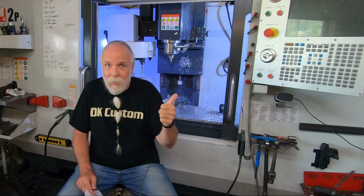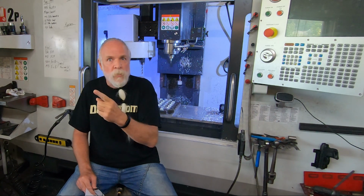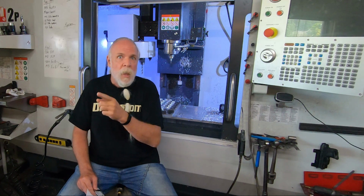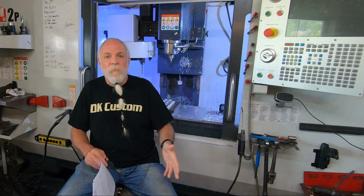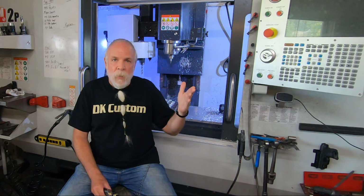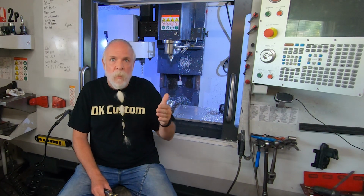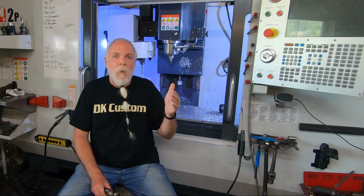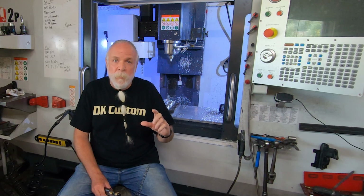So you want your air intake as cold as possible. You want your exhaust as hot as possible, but not from restriction or reversion. And then you want the cylinder walls to be at 190. So what we found, that if you have your engine running between 200 and 230 on a twin cam and 260, 270, 275 on an M8, that your cylinder walls are going to be very close to the optimum temperature of 190.